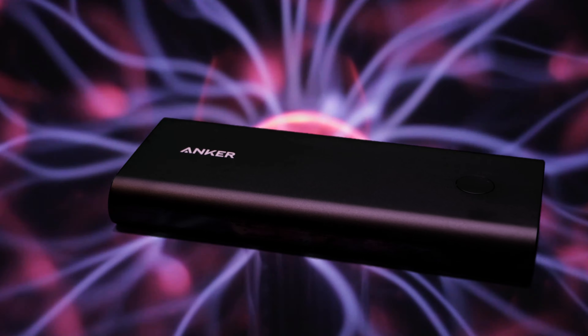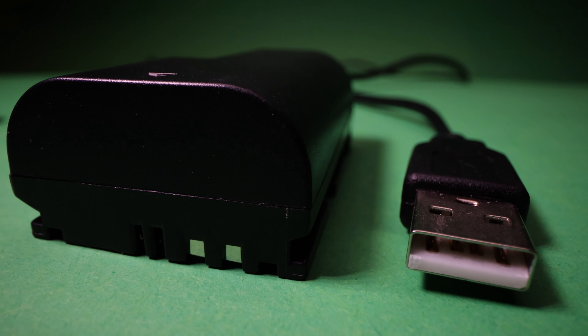The dummy battery — I'll put the link down below. I bought it at Adorama and it's an intelligent dummy battery. By intelligent, it means it regulates the voltage entering your camera to 7.2 volts, which is the same voltage received from the original Canon factory batteries. So I've found that this is a massive solution to overheating problems as well, because regular batteries will eventually build up heat inside of your system and that could cause the camera to overheat.